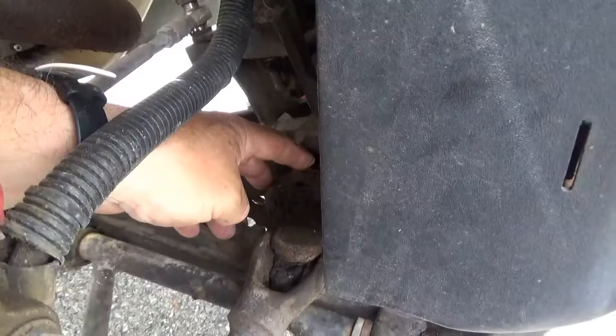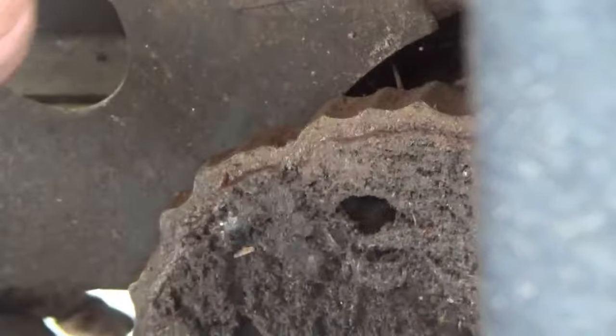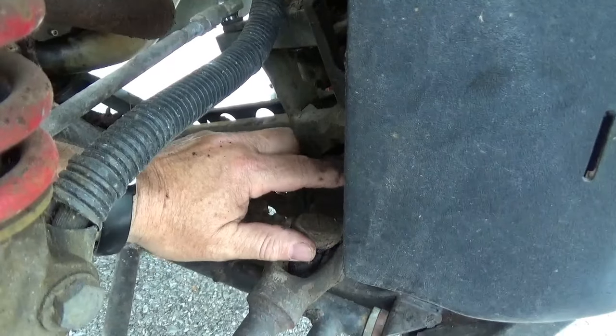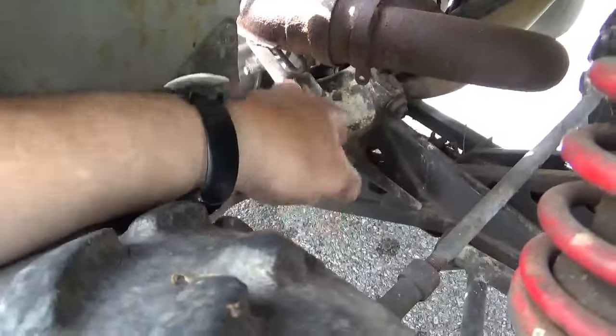You go from here to there and then again to the front axle. You can see that the front axle, where it's supposed to be driven by the chain, is completely buffed off — my buddy called it like a brake drum. This gear appears to be part of the U-joint assembly. One could take it all apart and grind the gear down and weld up a different sprocket.